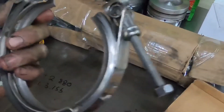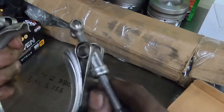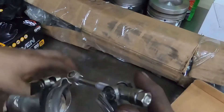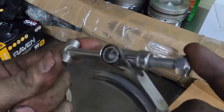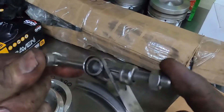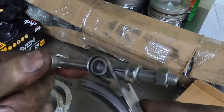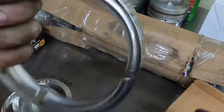They're 8mm bolts instead of 6mm bolts — super strong, really nice. But make sure, on any v-band clamp, you're not over-torquing them. These torque at 25 foot-pounds. And make sure you put anti-seize on the threads — this stuff is stainless and if you don't, it'll mar up and then it's all over.